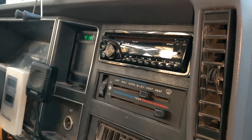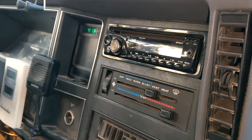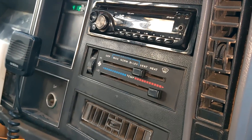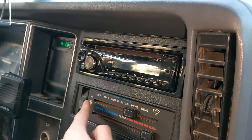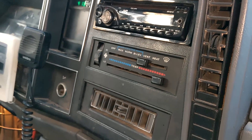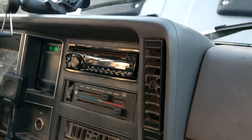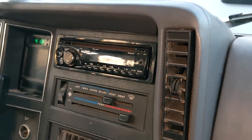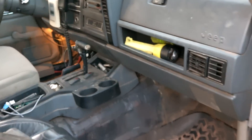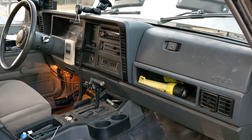The only thing not really covered is the selector switch and the switch over here. It's common for the electrical connector behind it to get corroded or pull off. Check to make sure that the electrical connector here is good before you replace the switch. That other switch is probably somewhere behind the dash, so if this is a problem you're going to have to take the bezel cover off and unscrew some screws, or maybe slide the radio out since it's open back there and you can look straight down. That's the short and sweet of why your blower motor may or may not be working. Hope you learned something.